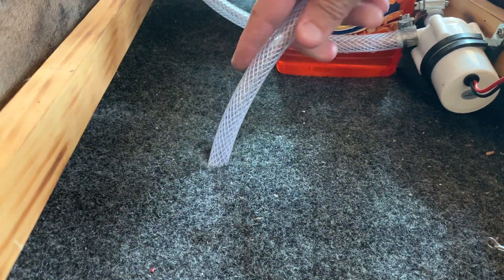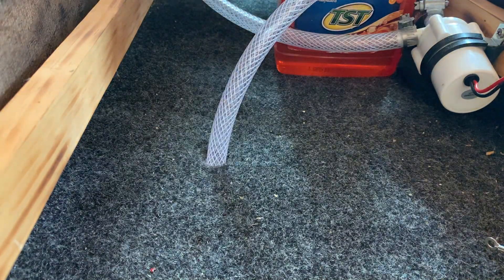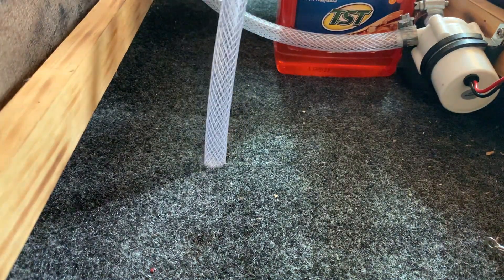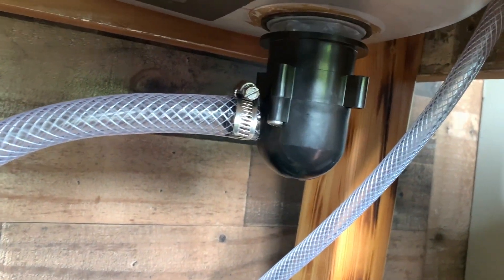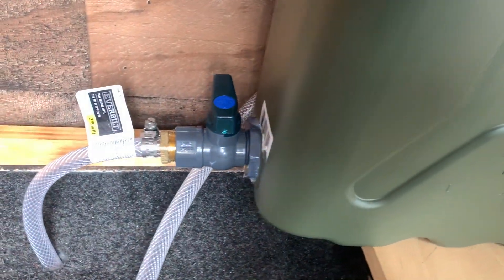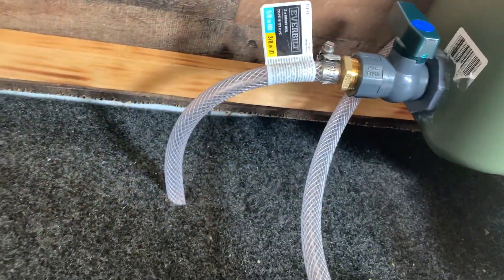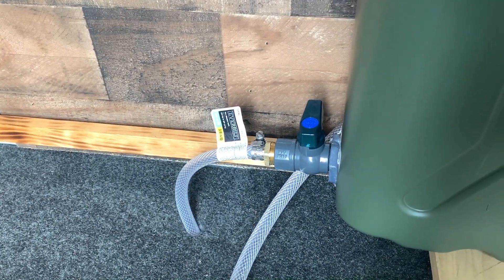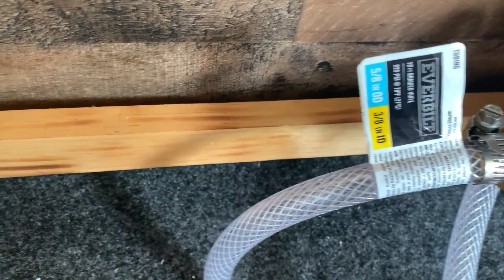That's good and tight. I'll just hang it out like that and get a little grommet from underneath — maybe just file up the edge. Then that'll go into the gray bucket. I got the gray tank set with the drain in it going outside. Here's my trap, got my drain hose going into my jug. I've got the drain on the bottom going out the floor of the van — it hangs down about two inches below the floor. I can put a fitting on that, and if I'm near a dump station I can dump it out, or if it's appropriate I can let it go on the ground. But it's sealed — it's really tight in there, so it shouldn't be a problem.